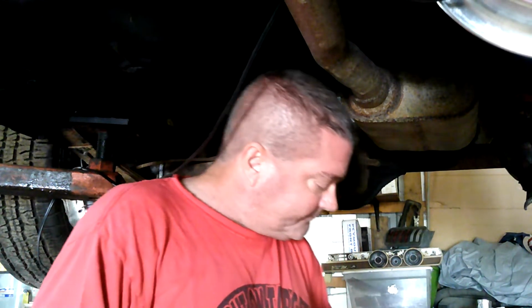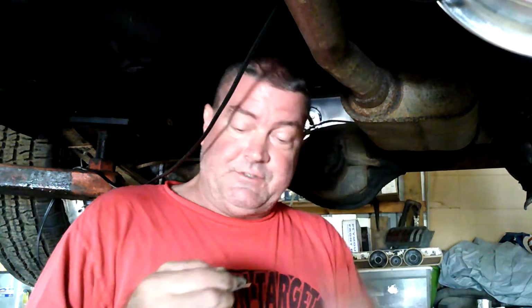It doesn't slide off easily. You really got to kind of wrestle with it. Instead of a nut and a bolt and all that, which is good too, but it leaves the terminal exposed where you put the nut. This is going to shield the entire thing. Even though this works off of a ground, if you accidentally get a ground, you're going to say full when you're not. And if anybody's ever run out of gas, not fun. So anyway, that's why I'm going to use this.